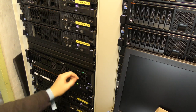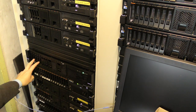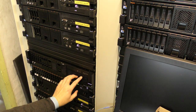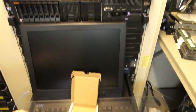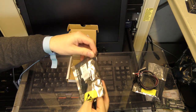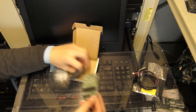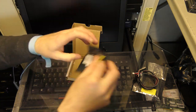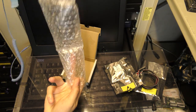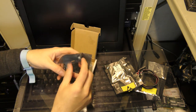So out here in the data center, first I removed the virtual machine from the Big Store, these three drives over here, and I deleted that drive in Proxmox, and I turned off the server. So now we should be ready to put in this cache flash controller here, which is, oh, that's not it, that's the wrong one. This is for the Model 4. So where did I put the other one? Oh, it's behind me. Maybe we should see them together. They're pretty much similar, but they changed something, so they're no longer interchangeable. So this is the one that we are putting in.